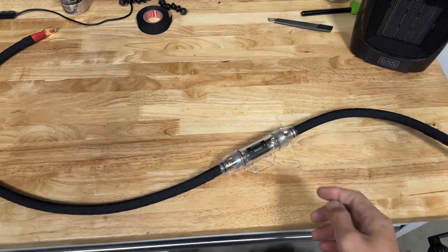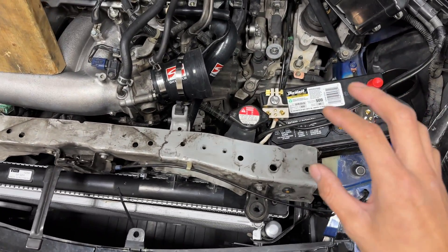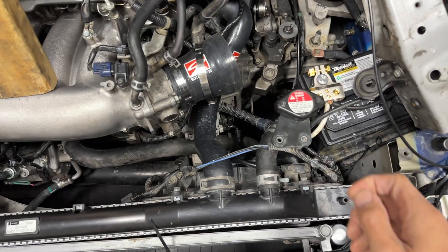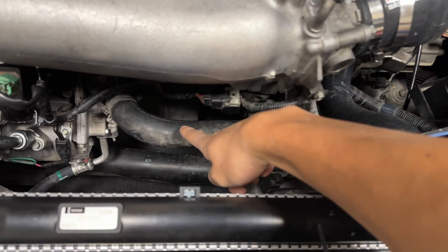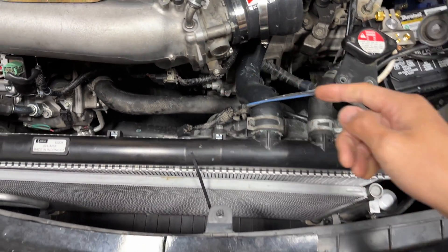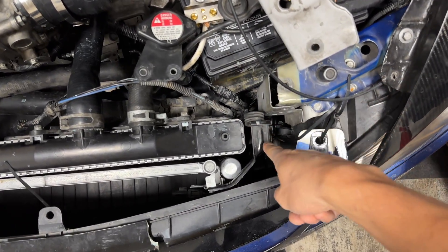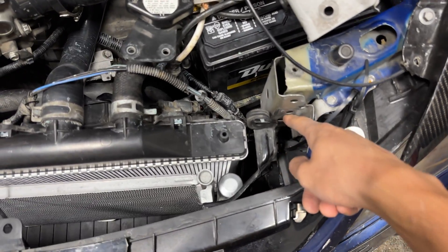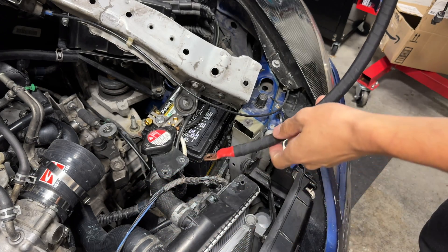The third part of the Big Three is the power wire. I made this harder than it needed to be because I added the fuse — it took a lot of time figuring out where to place it, since you want to keep the fuse within 18 inches of the battery. Going straight from the battery to the alternator, there are hoses in the way and I didn't want the fuse just dangling, so I decided to route it from the terminal by the headlight, zip-tied to the radiator support, and then it runs to the alternator.